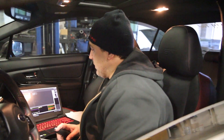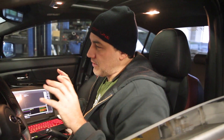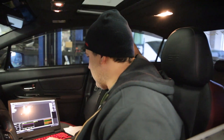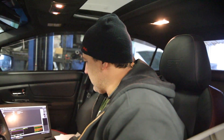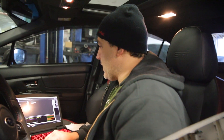I'm getting ready to start it. I've been working on the push button start and it's almost there — there's still a time delay I need to find. It's not quite right, but it seems to work now. The dash actually turns off, because it wasn't turning off before, so that's all good. The fans are on when the key is off, so I've got to figure that one out. There are no headers on the car yet and no coolant in it, but I definitely want to give it a little pop and see if everything's working.